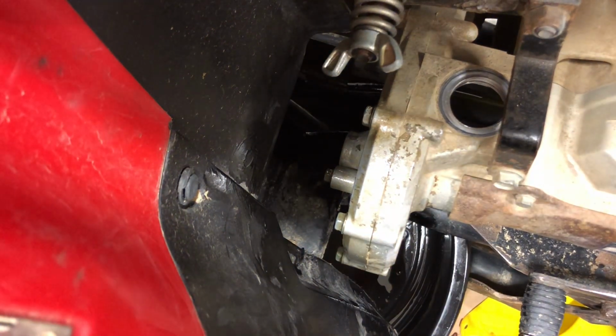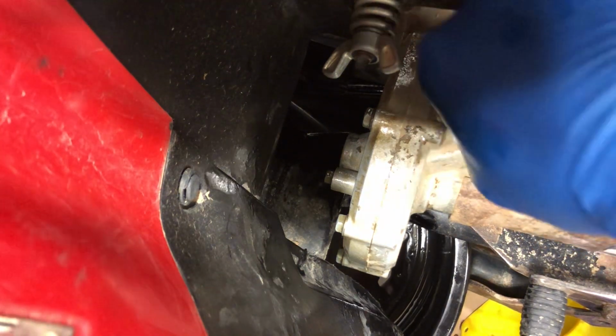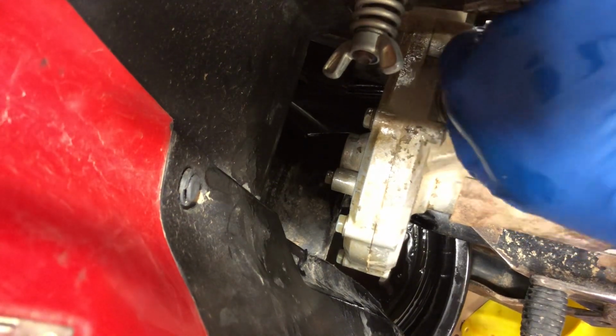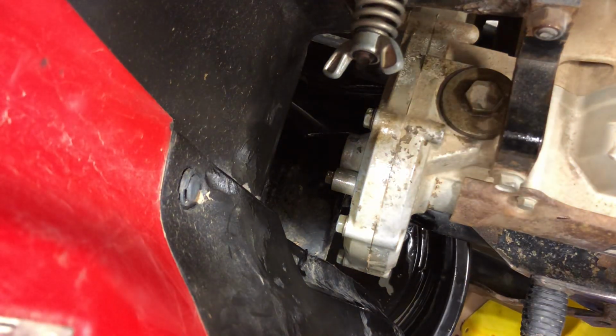Move that funnel now that the check plug is in there, and it's snug. And we've checked the amount because it's coming out that check plug. We can put our actual fill plug in, our check plug in, and we can put our fill cap back on. And I have my plow attachment, if you're wondering what that piece is in front of it. You may not have that on yours. I've got an old Cycle Country plow on mine that's the way they used to mount the handle for those to come up. A much older design, but it still works, so I don't change it.